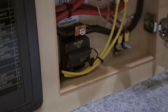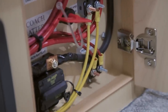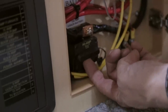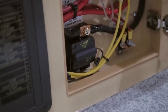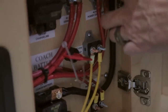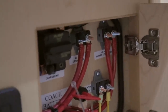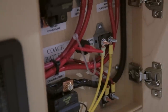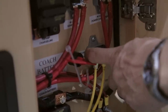In this compartment you also have manual reset breakers — larger breakers for charge lines and, for the generator, a high-amp breaker with a small swing arm that flips out to the left if tripped. There are also small shortstop breakers controlling the power sofa, fridge, and converter. To reset these, push the reset button on the copper post end until you hear it click.